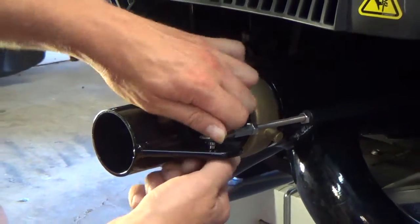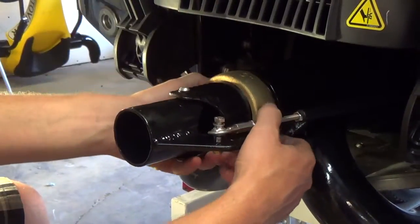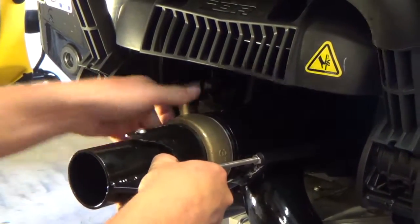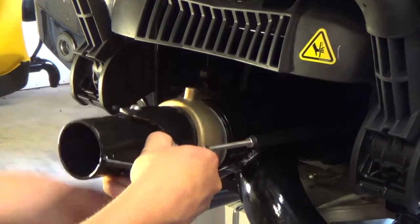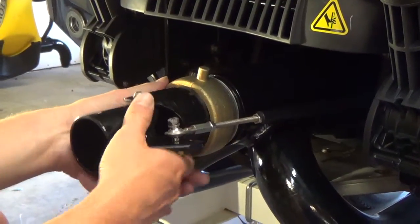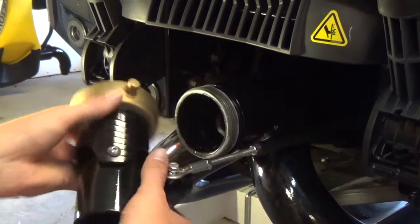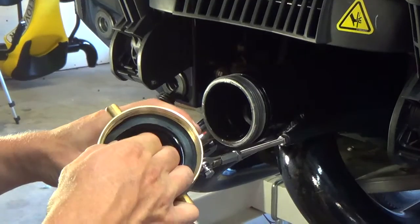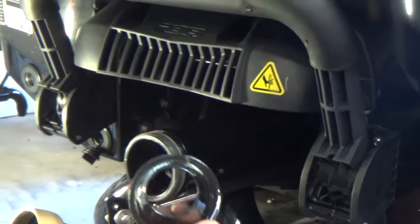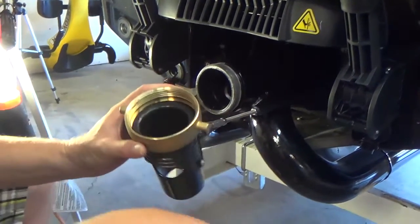Another thing that I can show you is the adjustable or replaceable nozzles on the inside of the steering. When you're on the lake, you generally do this when you're switching between riders. So for a less experienced rider, you'd use the smaller nozzle, as mentioned before, and you can change this out just by taking this off. You bring that around. This little rubber gasket needs to come out in order to get the nozzle out. As you can see, this nozzle is quite a bit bigger than this one. So if I was going to put this one in for a less experienced rider, just slide it in like that.